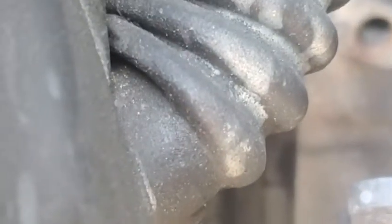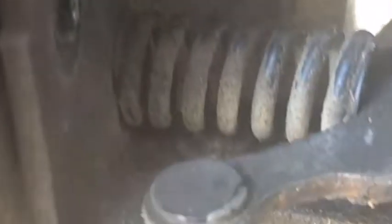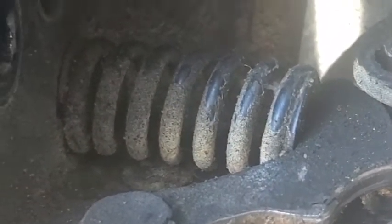You're going to need to use a combination of a ratchet wrench and a socket wrench. 1/4 inch is your best bet. I've also found a lot of these bolts were loose already. I guess over time, since this truck is several years old, they come loose. And there's one in the back there. That one was very loose, and I believe that one is used to really adjust the door in and out. I'm sorry, front to back. There are your bolts, I believe 10 and 13 millimeters.